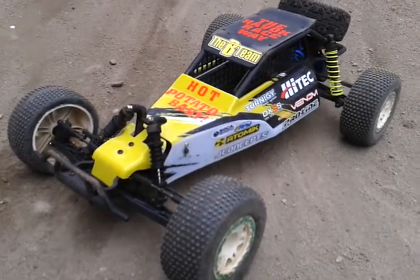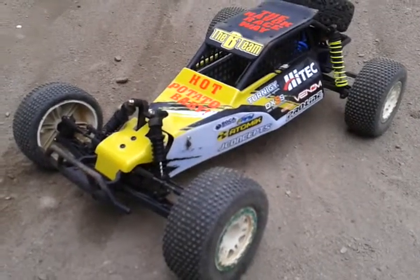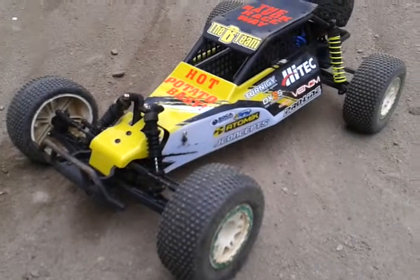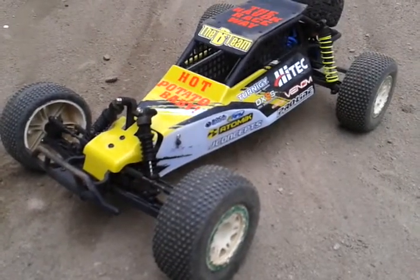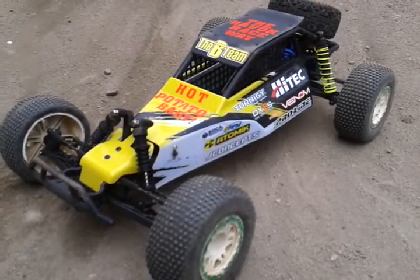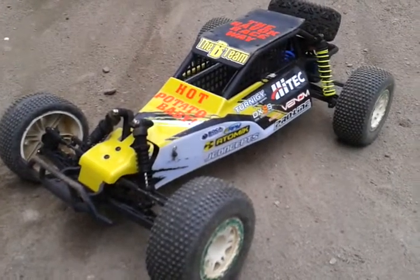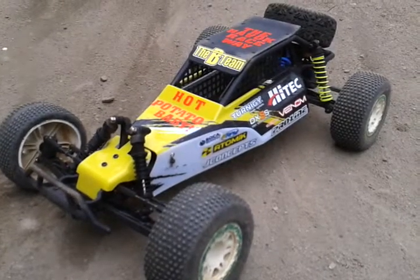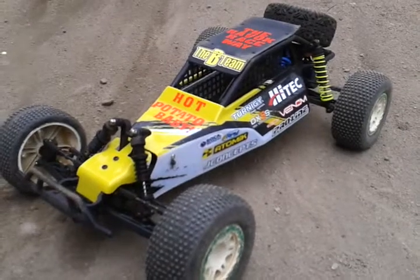This is the Turnigy Desert Buggy. Did some work to it, put new wheels and tires on it. Rear springs, got a front aluminum Blitz bulkhead A-arm mount type thing. Put hinge pins throughout it, put the correct bearings in it, correct screws, tightened a bunch of screws down. Still running the stock ESC and motor, put a DX3S radio system to it, Savox steering servo.